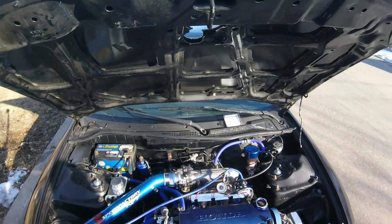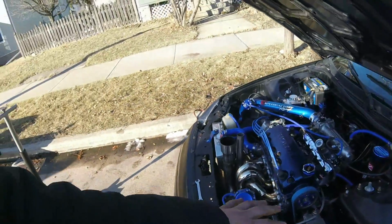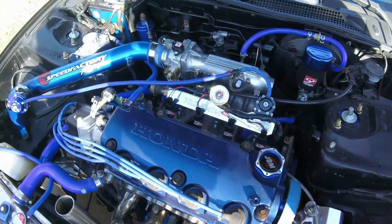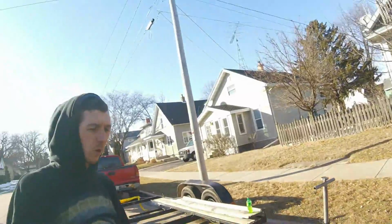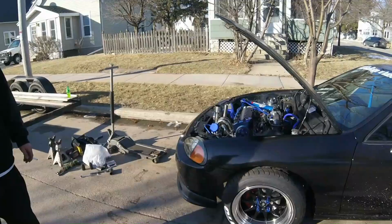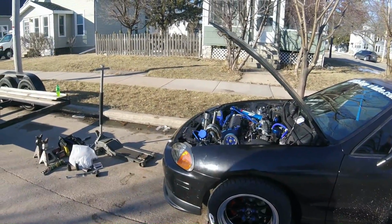He's got a Hondata S300 we're tuning it on. He's got a Brian Crower Stage 3 camshaft with Skunk2 valve springs and retainers in it. Got some RC 1000s and Golden Eagle fuel rail here. What fuel pump you got in it? Walbro 455. Okay, nice. What wheels are these? They're eBay. Just eBay? Yeah. Nice. They look pretty decent. Yeah, knockoff of the XXRs.